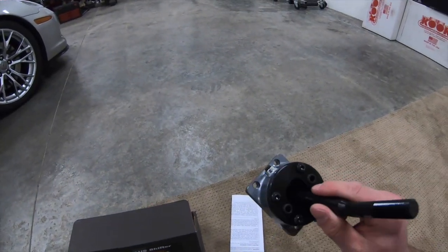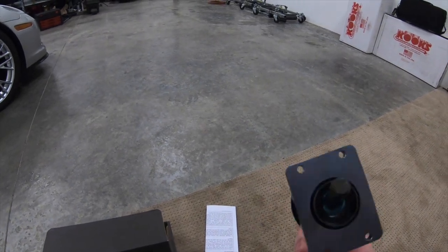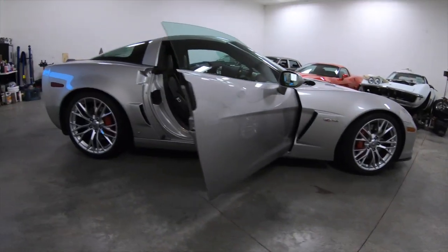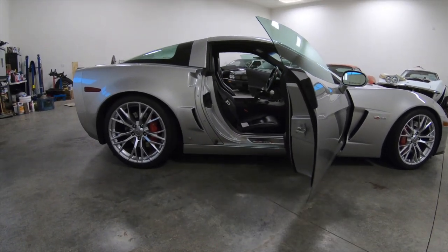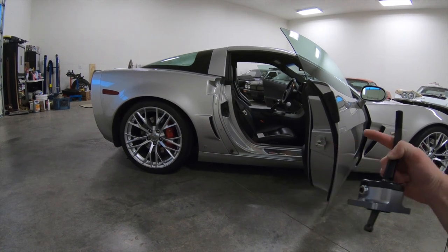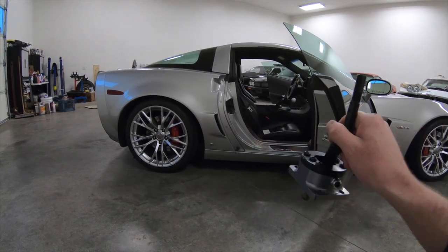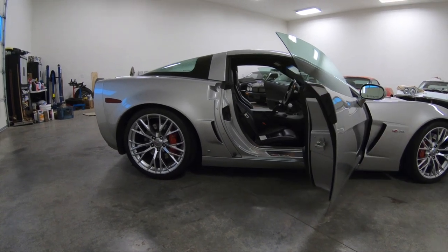Here it is — it really feels like a high-quality piece. These cars have a torque tube in them, and the transmission is actually mounted in the back of the car, behind the driver's seat. The shifter is mounted to the torque tube and has arms that actuate the transmission in the back. That's why this install is so simple — we're basically just changing the point at which the shifter meets the shift forks that go back.